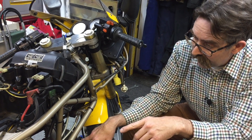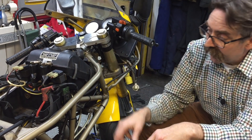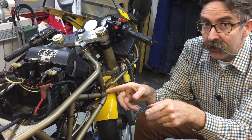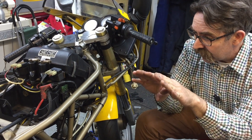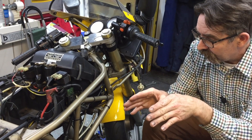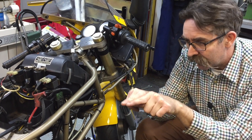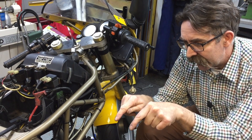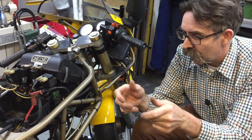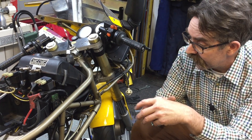I also managed to change the valve stem seals. They are a bugger to change because, as you've seen when I'm working on it, there's not a lot of room to get your fingers in. Also in their infinite wisdom, there's no chamfer on the top of the valve guide, so when you push the seal down it won't ride over the top of the valve stem and guide and locate in the ridge. What you have to do is with your fingers sort of stretch it over one side, get it over the shoulder and get it located in the ridge, then stretch it around the other side. Don't use screwdrivers or scribes or anything like that because you'll just tear them. They do go on but it's a real swear fest getting them on — but yeah, you can do it.